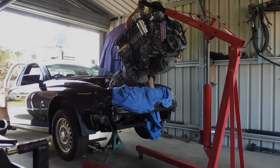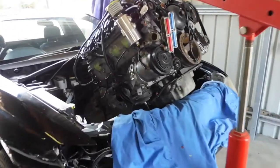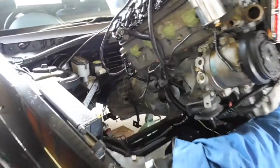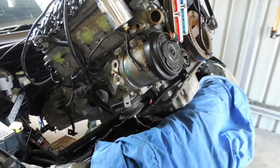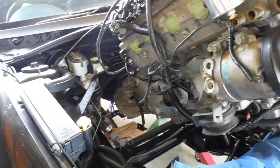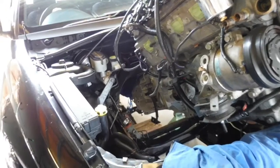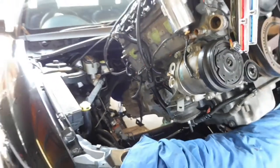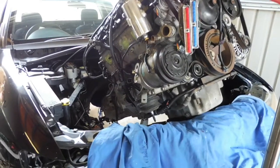On its way in. It did take a little bit to get it to here. Just poking the gearbox down, sort of lifting up on the front, poking the gearbox down, moving it forward, letting it back down a little bit. A lot of steps, takes a while, but you'll get it on clear of the cross member here. Haven't even tapped it once, I've been pretty good. It's on its way down the tunnel. So same again. Down a little bit, in, down a little bit, in, next thing you know it'll be in.